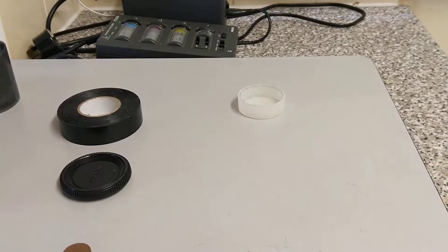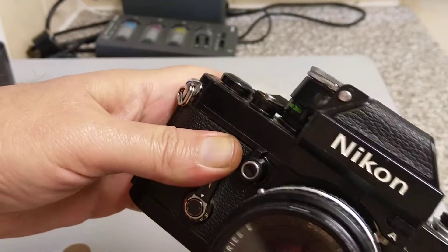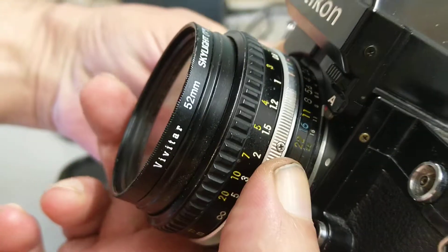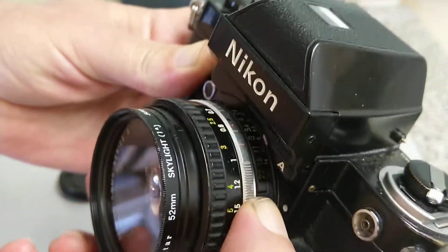When you look through the camera you can see the needle in the viewfinder, the selected shutter speed, and from the top of the lens you can also see the selected aperture — it reads the aperture through a little window up here. That's why there are two sets of digits on the lens; there's a little display on the back that gets read into the metering head, so it displays both shutter speed and aperture.